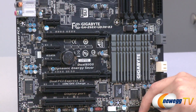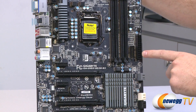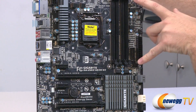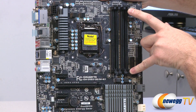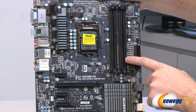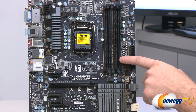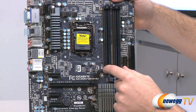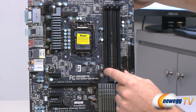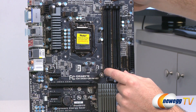Moving up the side of the board, we have a TPM port — Trusted Platform Module — right there. We also have our 24-pin main motherboard power connector. We have another case fan header right there — that's a 3-pin. Next to that we have our DIMM slots for our DDR3 memory. You want to use 1.5-volt DDR3 DIMMs. It supports up to 32 gigs of DDR3 memory — that requires 8-gig DIMMs, which are kind of rare right now, but 4-gig DIMMs work just fine. This is dual channel, so you'll want to buy your DIMMs in sets of two. It also supports DDR3 overclock speeds up to 2133 MHz, and make sure you're getting non-ECC memory modules for this motherboard.